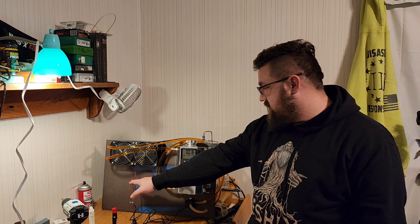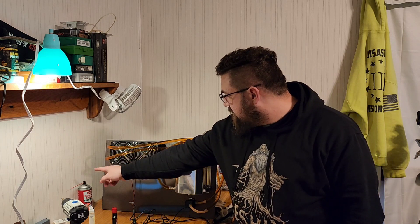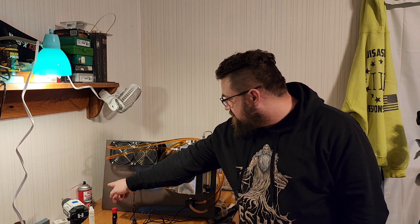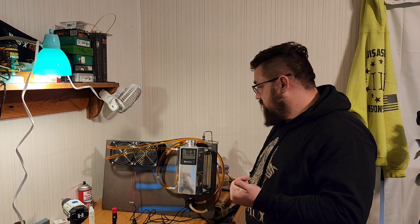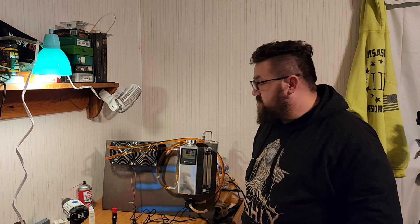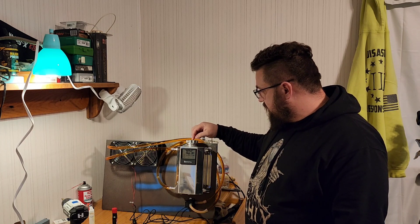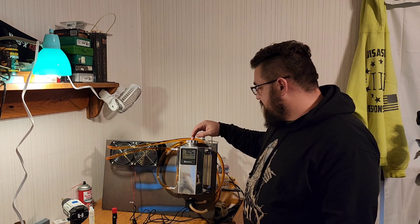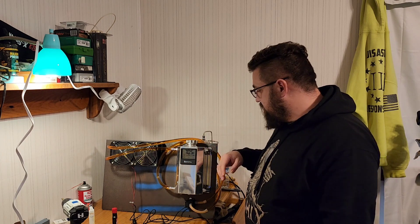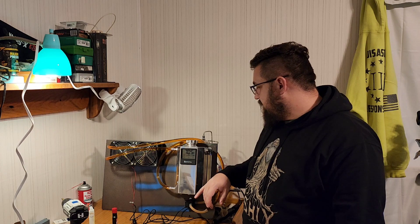We are going to go ahead and add another set of fans. This line will just get cut and go down into the top of the radiator, and then the bottom of the radiator will come up and into here. That will give us, number one, more fluid in the system, and two, twice as much cooling. Also, this cap is going to be fitted with little drink bottle ice cubes. This is 100% pure distilled water — no coolant in the system. I don't want it in case there's a leak getting on my workstation, or my pets or kid getting into it. It's distilled water with red and yellow food dye to get the color I wanted.